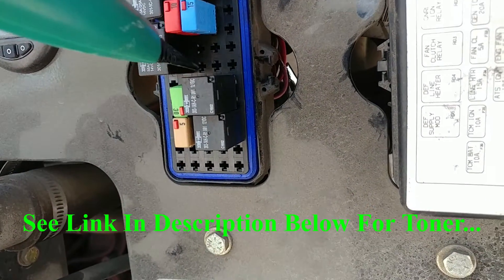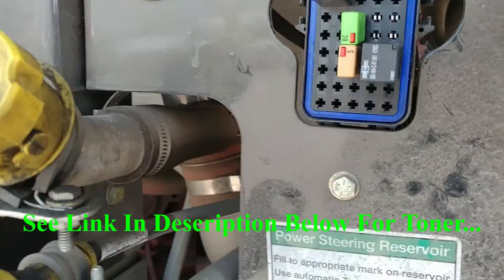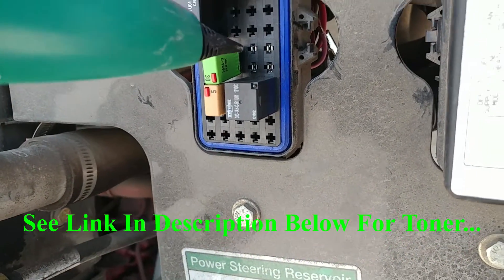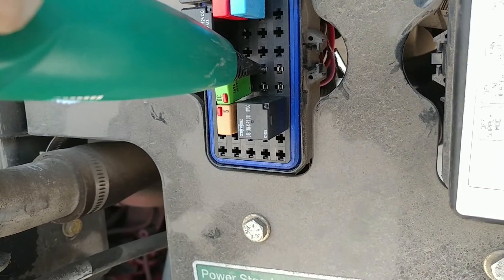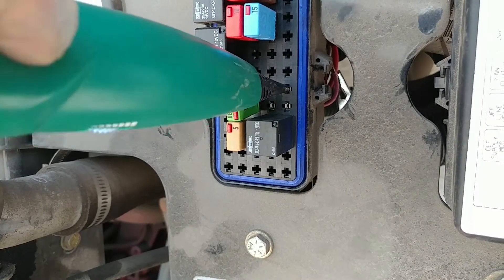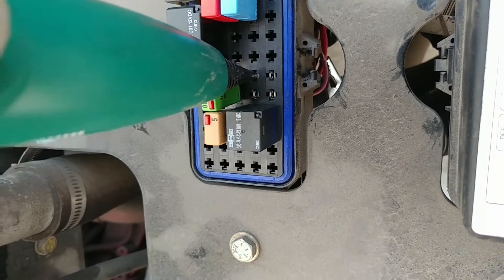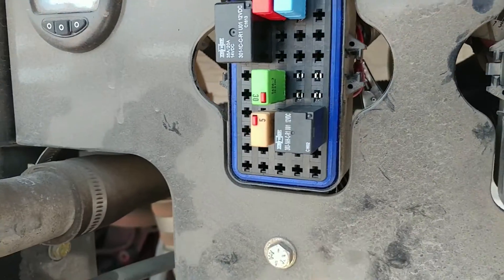We press the button on our toner and we get the tone. Pull the relay out and we try to positively identify the pin in question that is running to that solenoid. I know it's this one here — when I press the button it's much louder than it is at any other location. You can see how that works — once you get that tone, you know you're in the pond where the fish are biting.